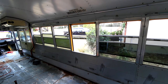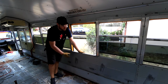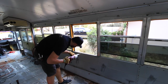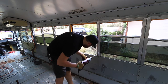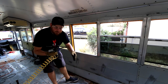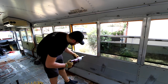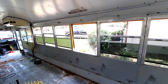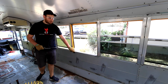Well, that works. And just like I thought, we've got six hidden rivets on that trim. These are the last six rivets that need to come out to take this big section of lower panel out. Sometimes when the heads are stubborn like this one here, I'll come back in with the punch and give it a tap - that'll make drilling out the rest of it easier. And now with a little bit of persuasion from the pry bar, we should be able to get the rest of this panel out.